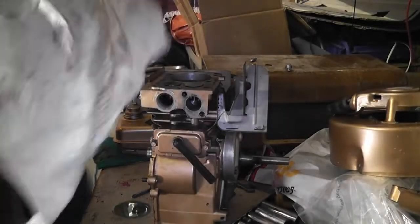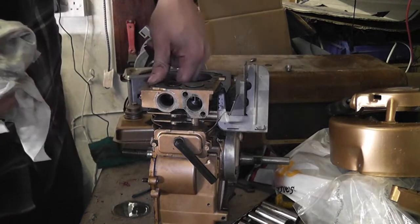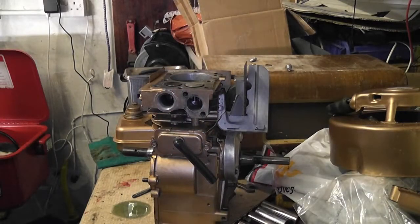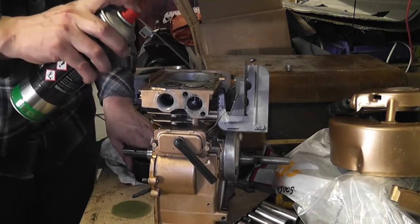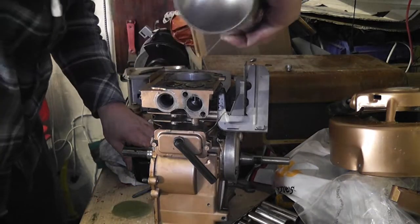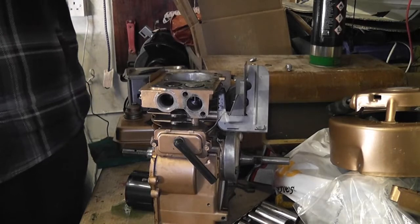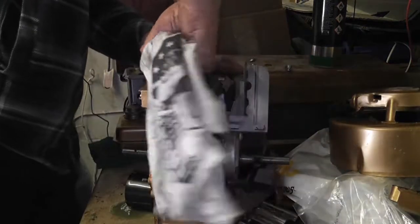Metal fragments all over it. There's definitely a bit of gouging in that cylinder. I think we might just get away with it though. I'll spray it with some electrical contact cleaner here now and see how. I'm wondering, was it valve lapping compound? There were some parts on the engine I blasted to clean them, but I'm generally very careful about cleaning that sort of stuff off after the fact.